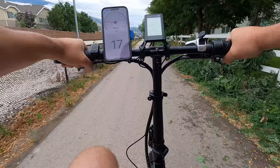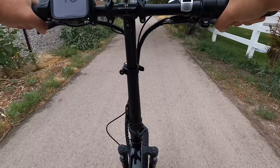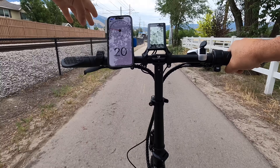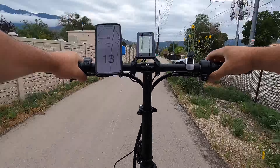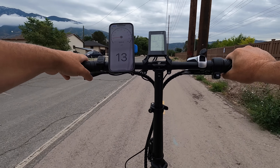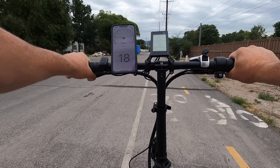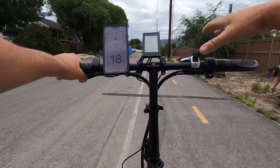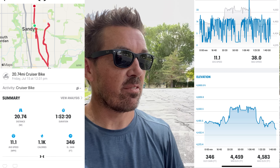Down to around 25% battery and I've gone 19.48 miles. Walking through pedal assist and throttle sensitivity: on Speed Mode 1 I'm at 60 RPM; Speed Mode 2 is pretty much the same resistance. There's a big jump at Mode 3 and it's close to my cadence. Speed Mode 4 is where the bike takes over at my regular cadence of 70 RPM. On Speed 5 if I really try to crank, I can get 18–19, maybe 20–21 on a slight downhill. With the throttle, it's about an inch before it engages. Very easy to maintain a certain speed — it's not all or nothing. Going 13 mph and punch it: immediate power, but pretty slow to ramp up. Release it and it instantly cuts off.